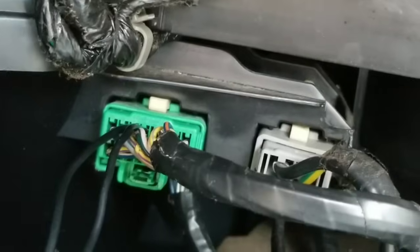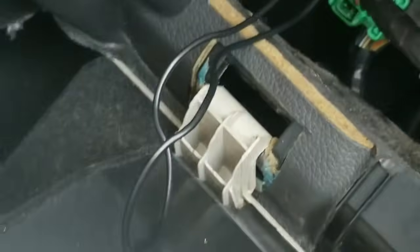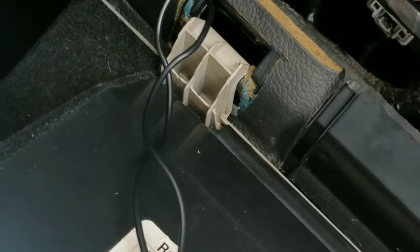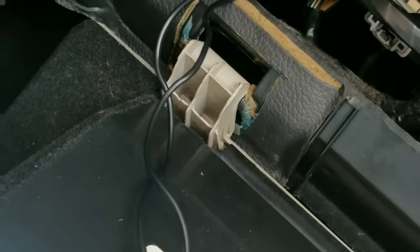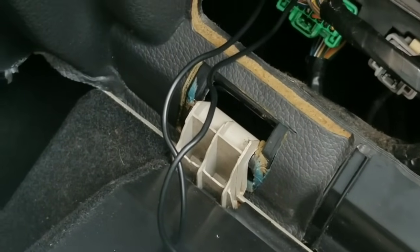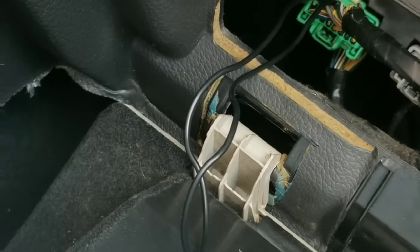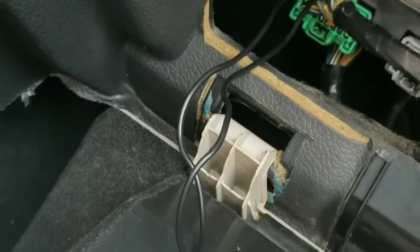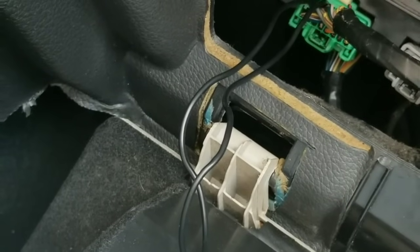There's no real fear of causing any damage. The purpose of the evaporator temperature sensor is basically to make sure your evaporator doesn't freeze up — but in Mississippi at 95 degrees, your car is not going to freeze up. It's not a big deal, because most cars prior to 2001 or 2002 did not even have this part on them. So it is a quick fix.